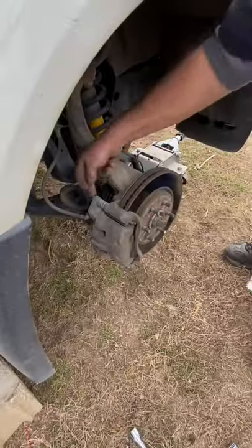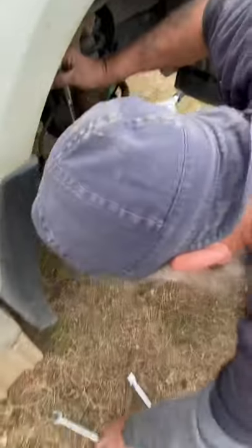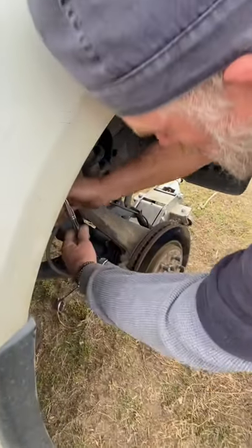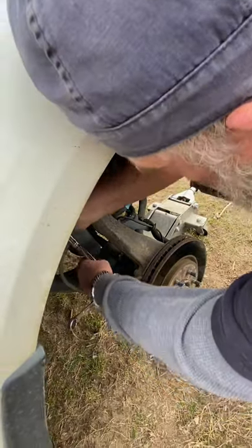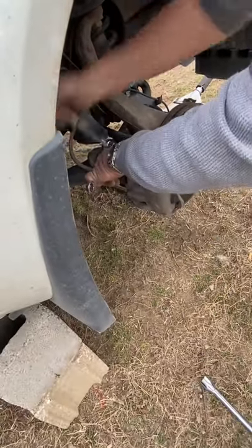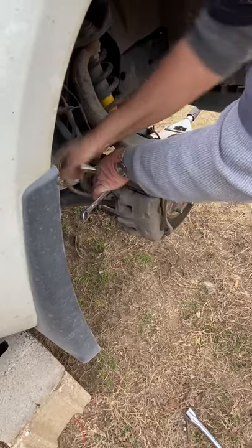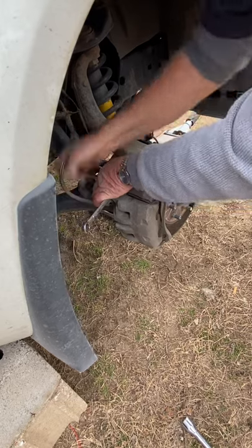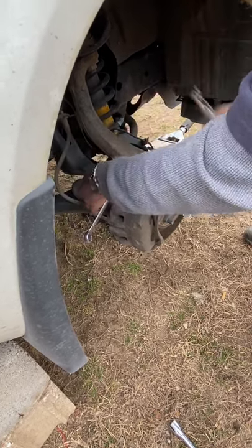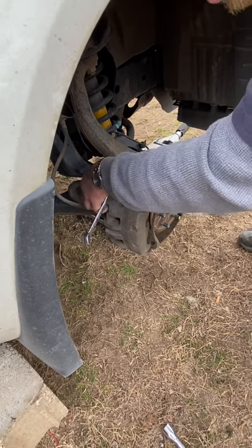See this nut right here — this has got to come loose, and there's a backup nut right there which is 11/16th. Just stick your wrench in there to kind of hold it. It's a real short bolt, it's not very long, it should come right out. This shouldn't take but about 15 minutes to do, and the dealerships are charging you out the wazoo for this kind of work.